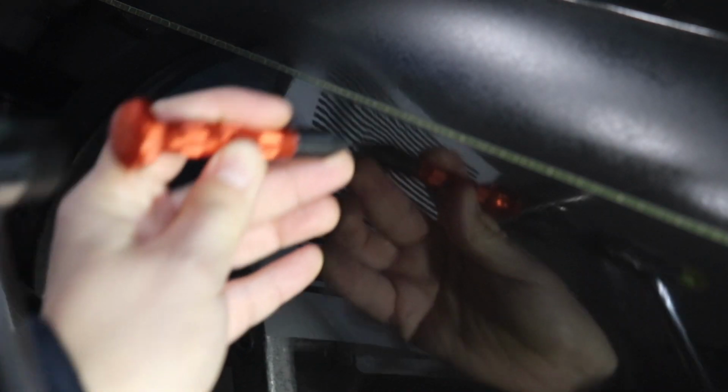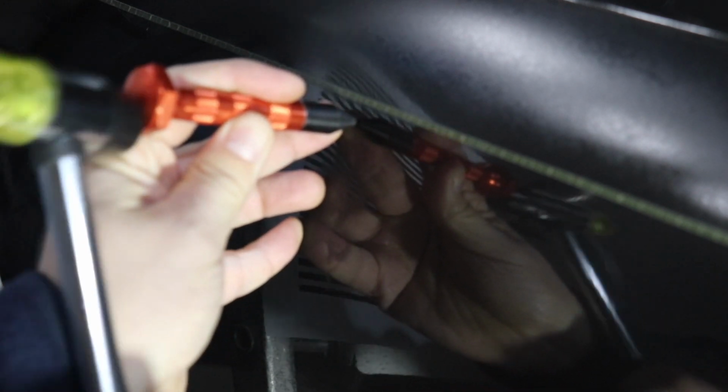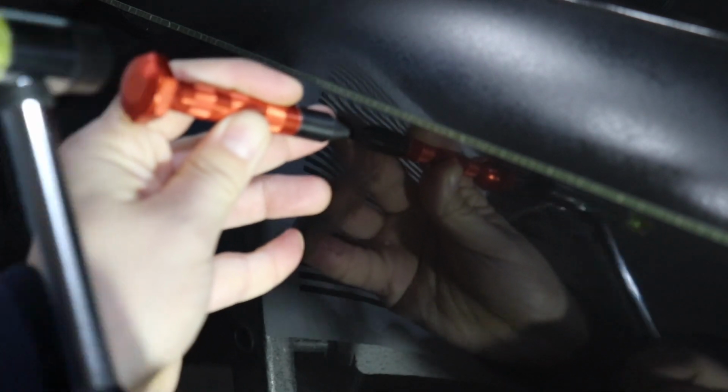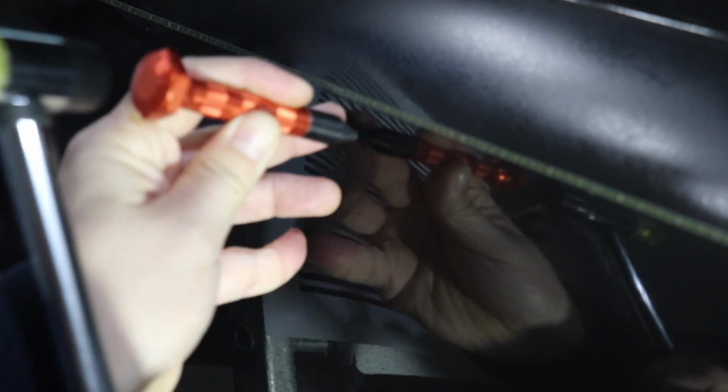Here you can see the dent clearly when you look at the black and white wavy lines going through the middle of the dent. So the first part is to obviously ensure that the panel itself and the dent is clean of dirt and grime. Second step is using the small hammer and tapper. I lightly tapped around the dent. Watching the YouTube videos suggests that this helps relax the metal and releases any stresses in advance of the big pull.